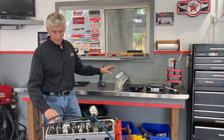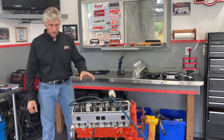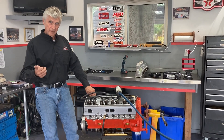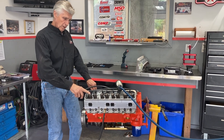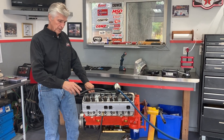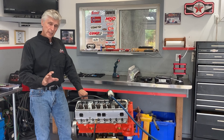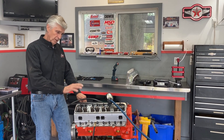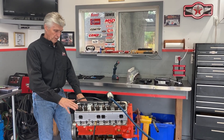Since the last video, I did a mockup and checked piston-to-valve clearance — over 300 thousandths of an inch. I checked rocker arm and push rod ratio, push rod length, and rocker arm engagement. That's all good. I'm not making a video of that right now, but there are videos on my channel from the past covering all these functions if you want to find them.